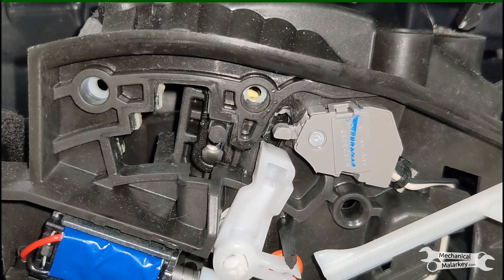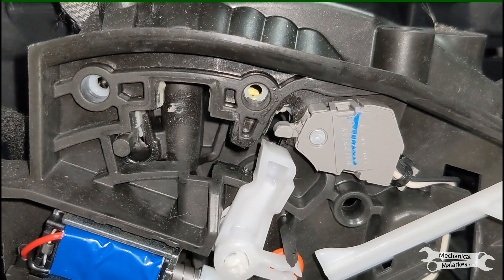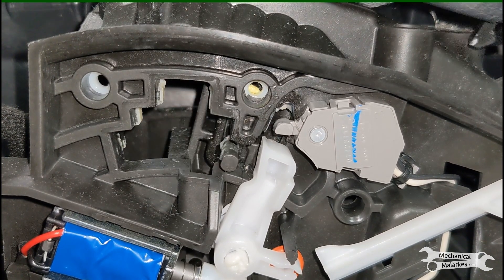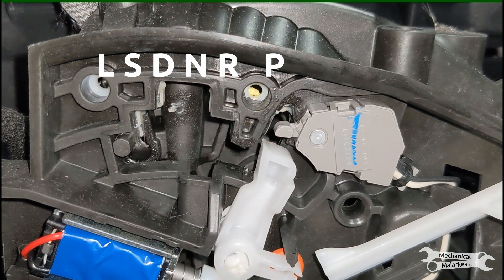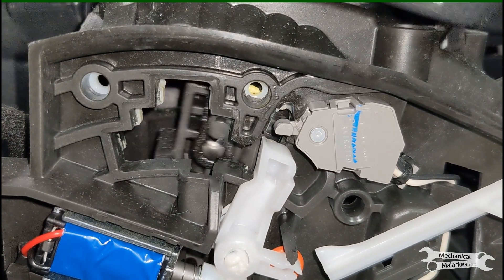While I was checking things over I realized that once I had moved the shifter into the reverse position, I could then move it between different positions without ever having to push the button on it like I'm supposed to. I could move it from neutral to reverse without pushing it, or from drive into a lower gear without pushing the button, which usually you have to push to make sure you're not doing it at the wrong time by accident.